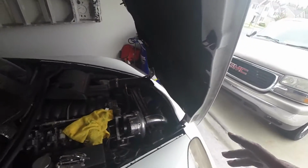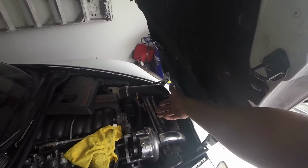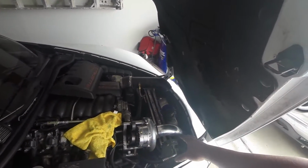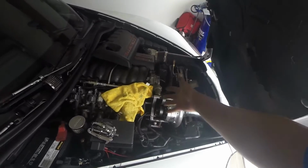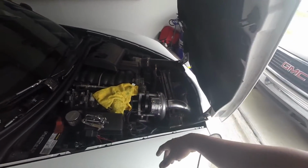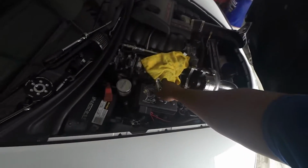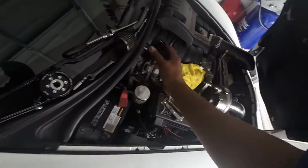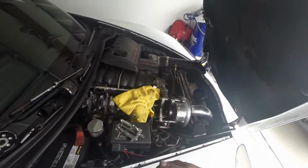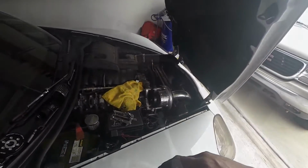Pretty much simple with the ECS kit. You take your belt off with the belt tensioner. Had to loosen up the bolts for the supercharger. Put on my pulley puller, pull it off. Had to take off the snout for the oil to be able to get enough leeway, and in the next video I'll show you, it'll be on.